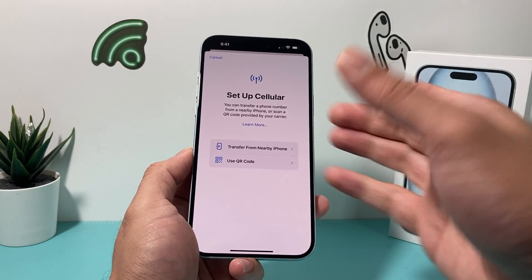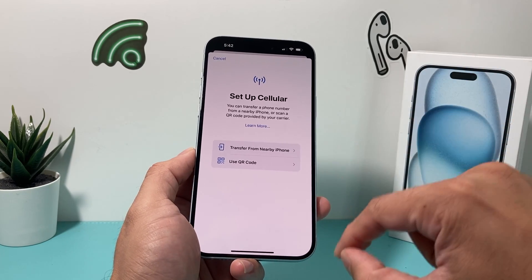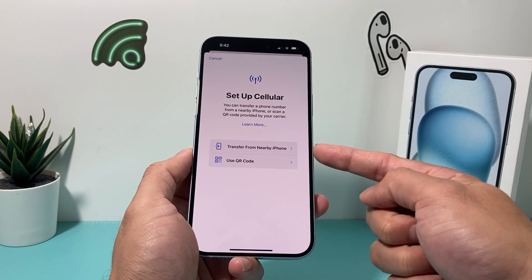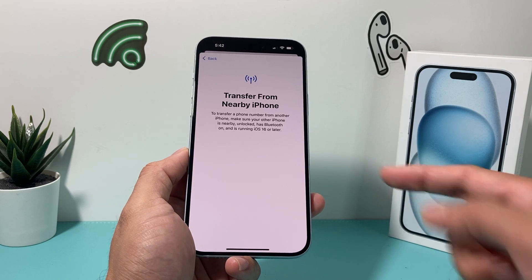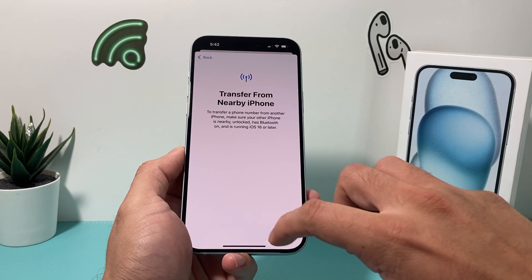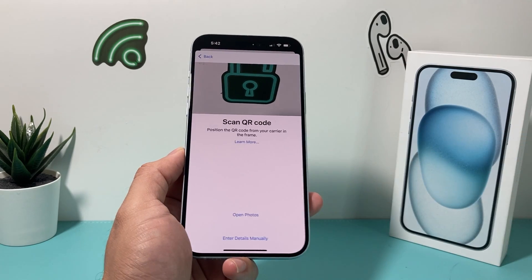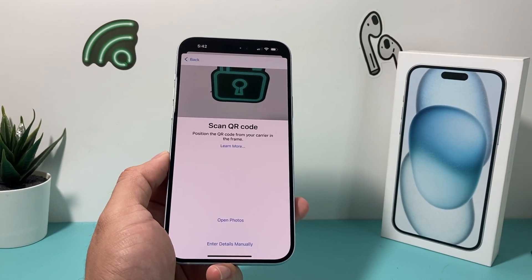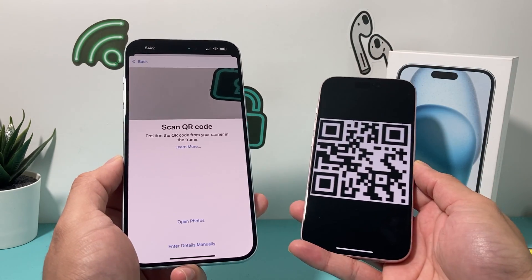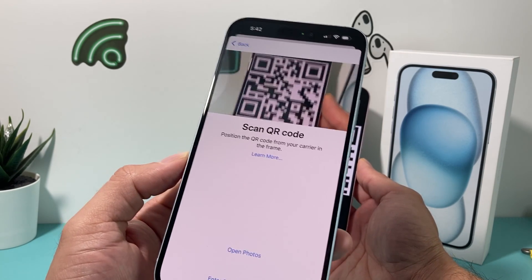This is the menu that will come up in the process if you don't already have an eSIM on the phone. If an eSIM comes with your phone — if you're getting the phone from the carrier — you won't have to do this step because it should automatically already load up that eSIM for you. But if you need to transfer it, you can click on this option, and if you have an iPhone with iOS 16 or later and hold it next to the new phone, it will transfer all that information over. The other option is if you get a QR code from your carrier, you can scan it — they're going to email it to you most likely. All you'll do is scan it like this and it will have the data it needs in order to activate your phone service.